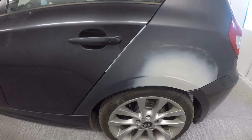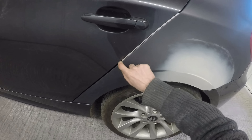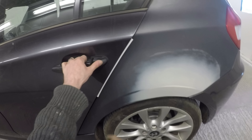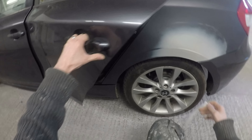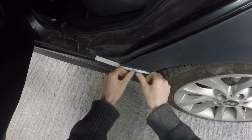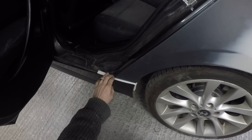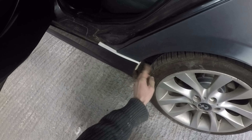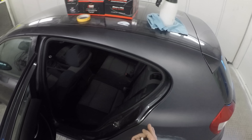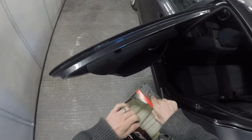You can see it's all poking out, but with one little wipe with your finger it goes in perfectly even all the way along. It's the same distance on the door shut top to bottom, and because it's not stuck in place it works a little bit like their no-blend edge foam. The overspray from the spray gun allows it to flex a little bit, which gives you a really nice feathered edge. It can also be used for gaps like at the bottom, and with it having adhesive it will stick in place — then you can just edge tape up around that.